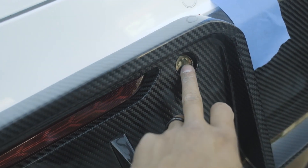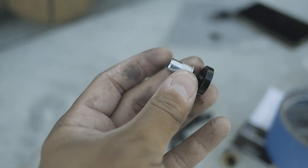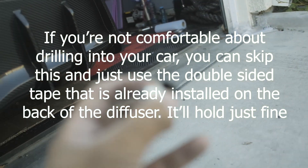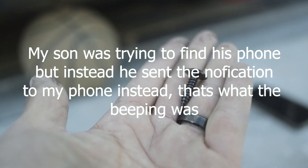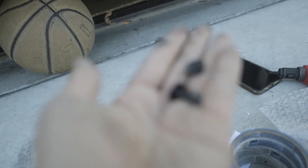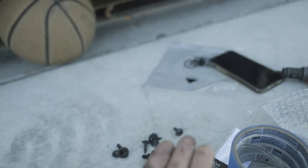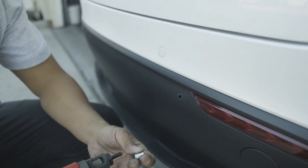There are two indentation holes, one on each side. They provide countersink washers and stainless hex bolts — looks like M6 riv nuts. I've got my drill bit ready. I'm going to drill a pilot hole for the screw, remove the diffuser, drill a bigger hole to install the riv nut, then put it back on — securing the top first, then the bottom with either self-tapping or nuts and bolts if I have access to the back of the panel, otherwise I'll riv-nut all six points.